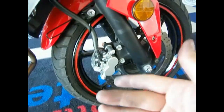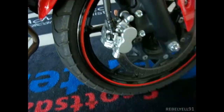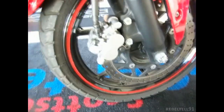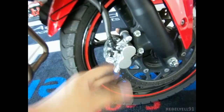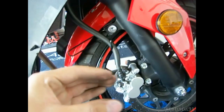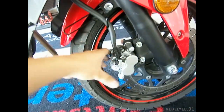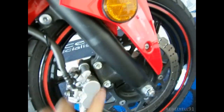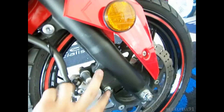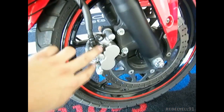And then you put the pads back in. You align the pads with the mounting shafts. You put the mounting shafts all the way through. And then you make sure that the mounting shafts are tight. You move the pads so that you have room to get onto the rotor. Then you put the caliper onto the rotor. You line up these two mounting bolts, put the mounting bolts in, and lock them in there. Go to specified torques on the mounting shafts.